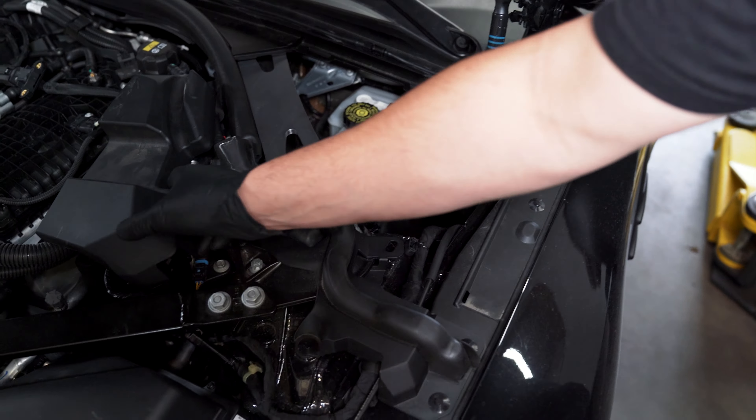We've got to run all these wires to our map sensor here — this is also gonna be the first place we're gonna be plugging into our electronic wastegates. We'll route all these wires under these fuel lines here and by these ECU connectors. Once you get this in the engine bay you've got to kind of figure out the best way to lay everything out. For those of you with aftermarket intakes and intercoolers, the routing may be slightly different, but there is no 100% right way to do this — it's really just routed the cleanest way possible.